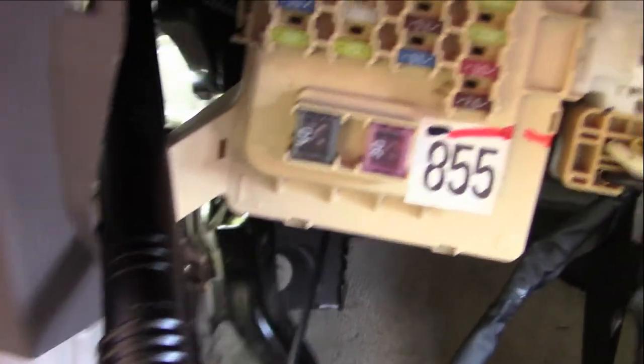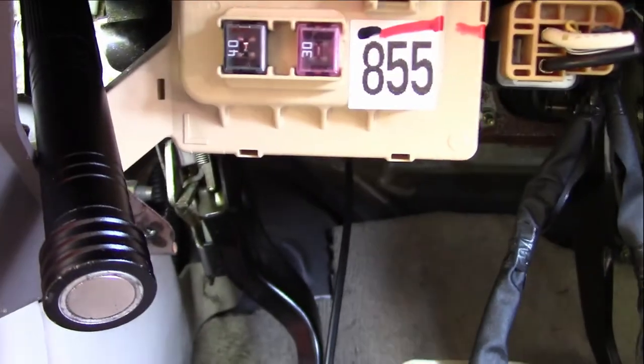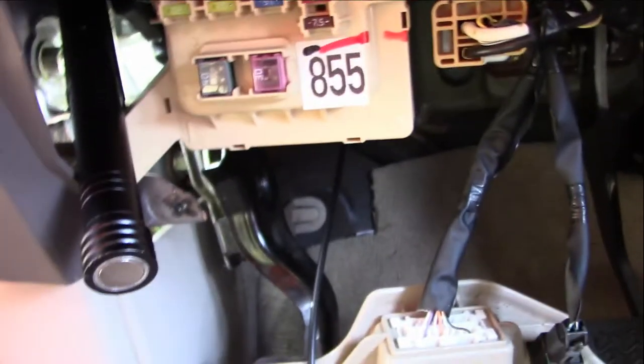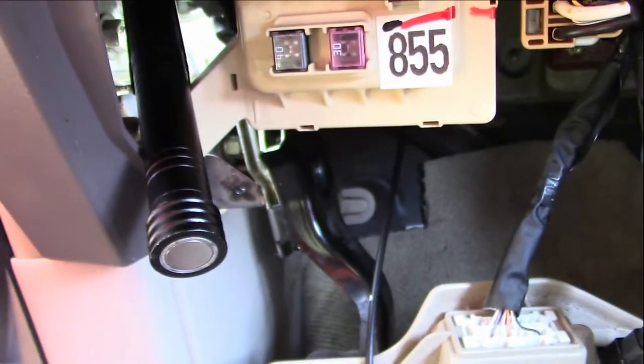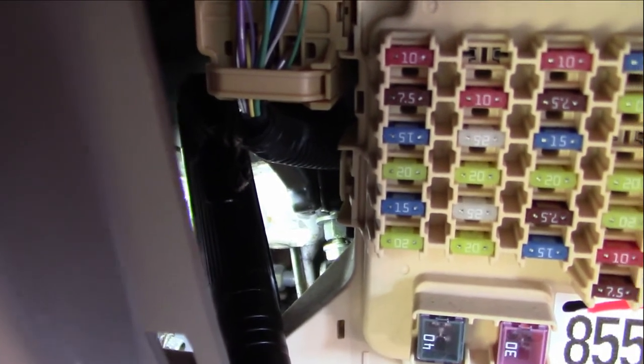Essentially what the brake pedal does is it goes really loose — it goes all the way to the floor when you push it and doesn't really work very well. I crawled underneath and the cable is really, really slack. So we're going to go ahead and tighten this up just a bit to take the slack out of the cable and make it more usable, because right now it really doesn't hold well. I'm not going to over-tighten it — you've got to be careful of that.